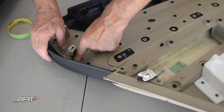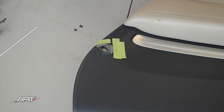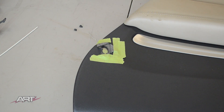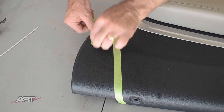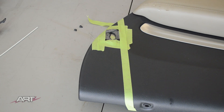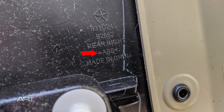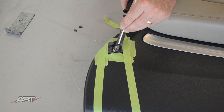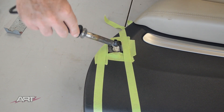I'm going to put a piece of tape here in preparation for working on the face — something to hold the plastic as I weld it in. I'll keep these flaps down with a little bit of masking tape. The black plastic on these panels is made of ABS, so that's going to allow me to use my white ABS rod. This way we know we're going to get a good solid bond.